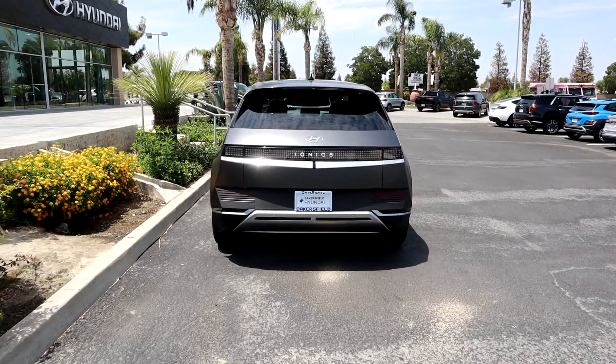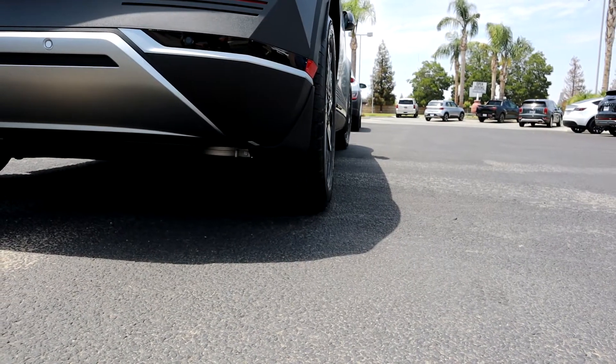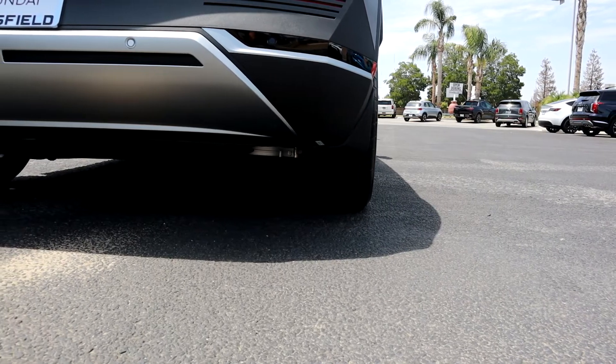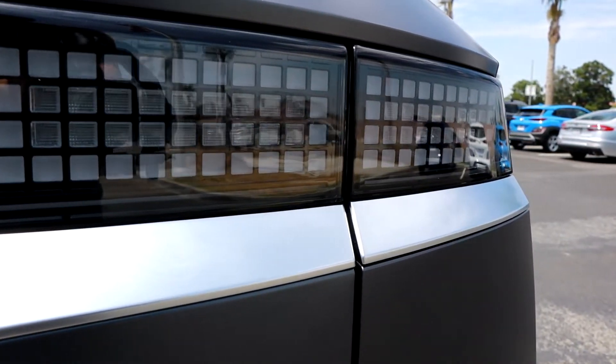If we take an example car charging port from a non-Tesla — my dad has a Hyundai Ioniq 5 — that car has a really exceptional charging port. It can accept 11 kilowatts of power, so basically any home charger will almost not be able to keep up with that. In that case, the EVSE — electric vehicle supply equipment — is going to be the limiting factor. The only type of EVSE that can surpass 11 kilowatts would be something like a Rivian wall charger.